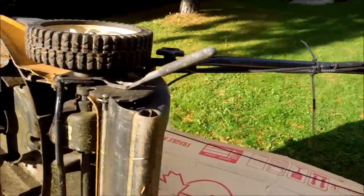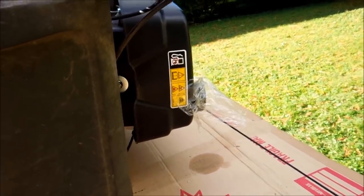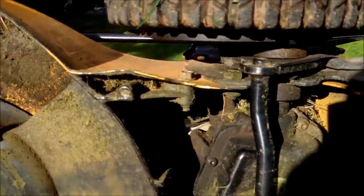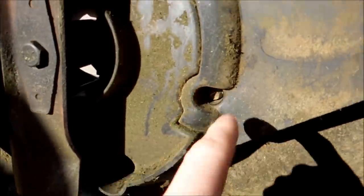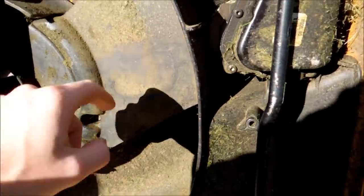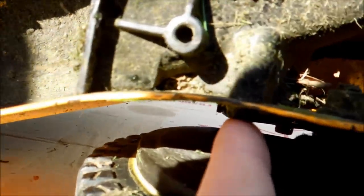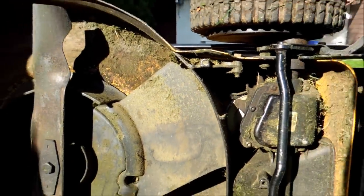Once you tip it, just a quick thing for you: if you have a suction gun, suction the gas out. We didn't have much so it wasn't a great big deal. But if you take a look right here, there's a 10mm bolt — take this one out. There's also another bolt right here — pull that one out. There's also another one right here, so pull that bolt out too. Once you pull all of these out, we can work this tray out. I'll let you know if there are any more bolts to remove.